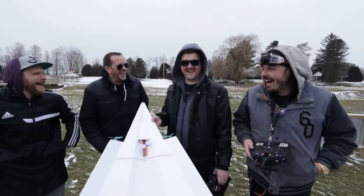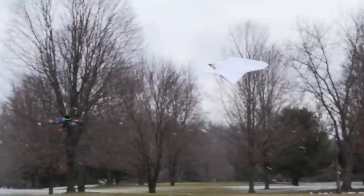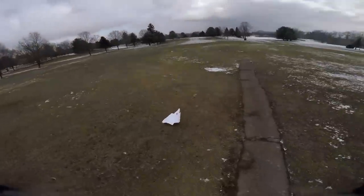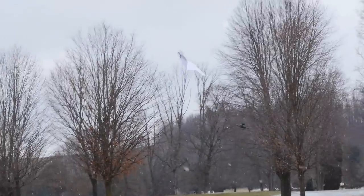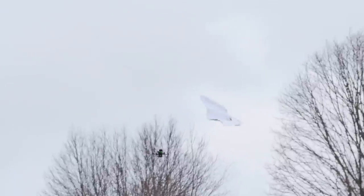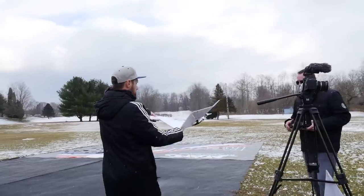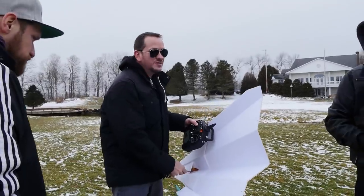How about you go first? Look how slow it is - oh my gosh, Noah. Let's see if I can turn it. I have no control with the elevons other than maybe a little pitch, but I have lots of control with differential thrust. I'm going to dial in some crazy expo on my rudder channel to give me softer differential thrust and try it again. But I've got a floppy servo here - I'm out for the count. Long story short though, it flew.